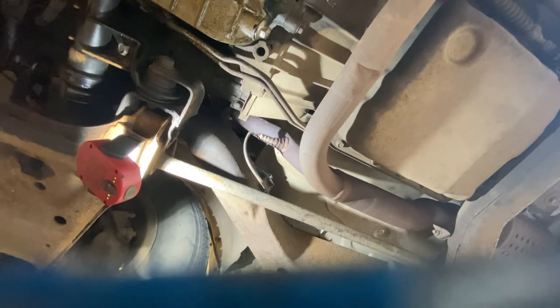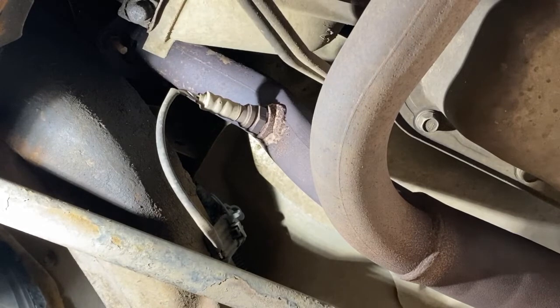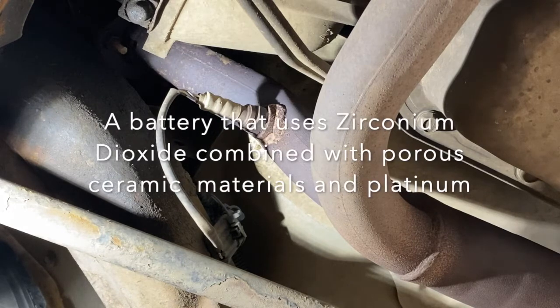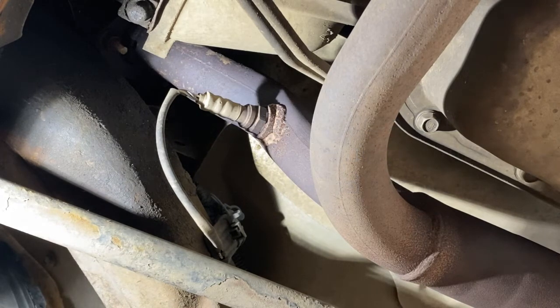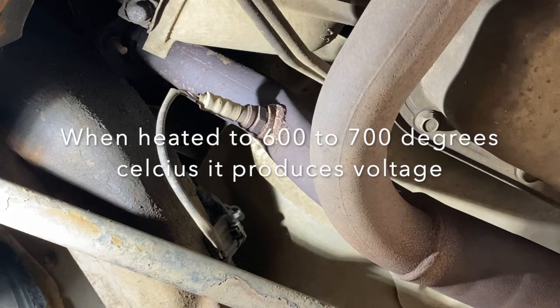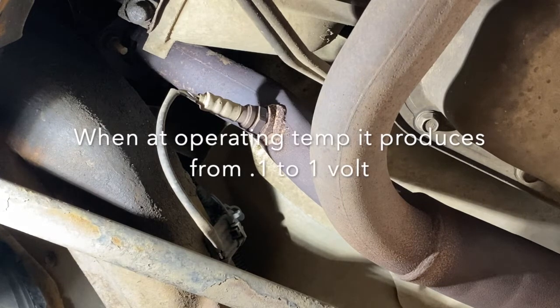Now, what is the oxygen sensor? We're going to zoom in on this a little bit and take a better look. This is on the front exhaust plate coming off just off the one manifold a few inches. That oxygen sensor is essentially a battery. It has a zirconium dioxide inside of it, and that zirconium material along with a ceramic material which acts as an electrolyte in the sensor is able to sample the outside air compared to the inside of the oxygen sensor's values when it's in the exhaust stream. The difference between the outside oxygen levels and the inside oxygen levels in the exhaust pipe allows that little sensor to act like a battery and generate a small voltage signal to the computer.